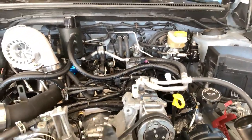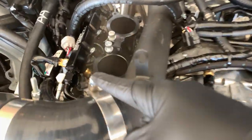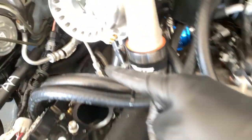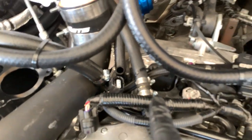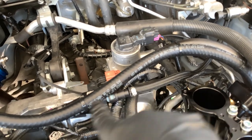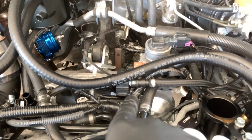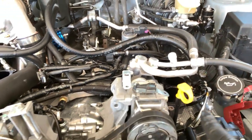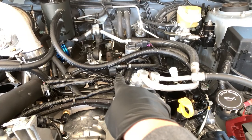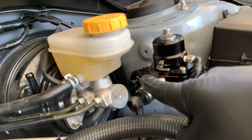Guys, it is worth the money. I know it's a $200 add-on but I promise you it's worth it. We did get the fuel line — we're running dash 8 across the front and dash 6 in the back. The fuel source comes across and goes into your flex fuel sensor. It's pretty much an inline system that reads the ethanol content in the return line. So after everything's gone through the fuel rail, it does a loop, goes through that sensor, which tells the computer what ethanol content is in there, and then that runs over as our return to the side of the regulator.